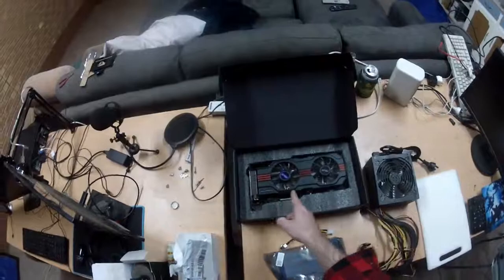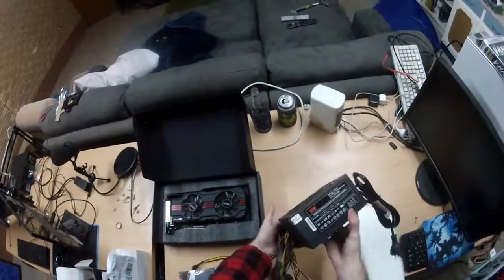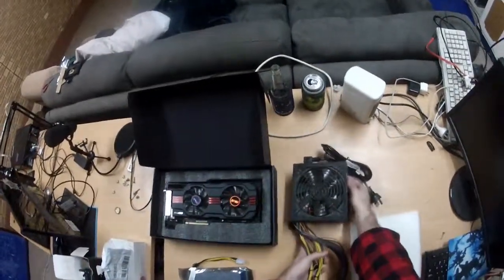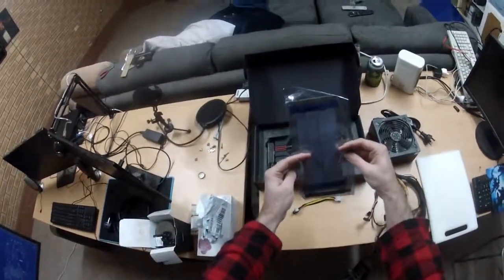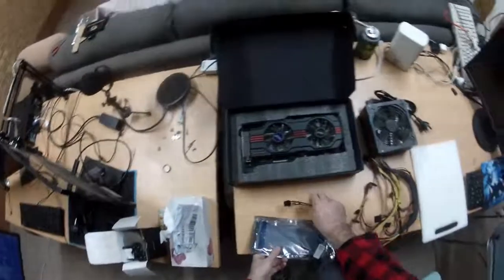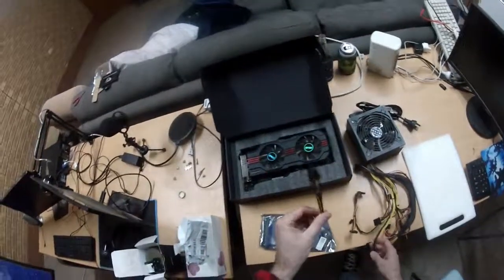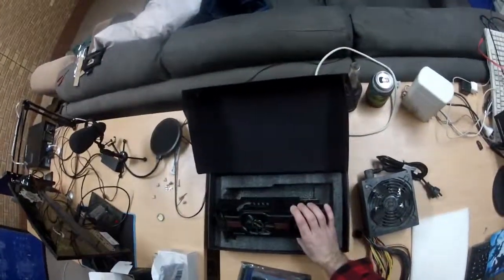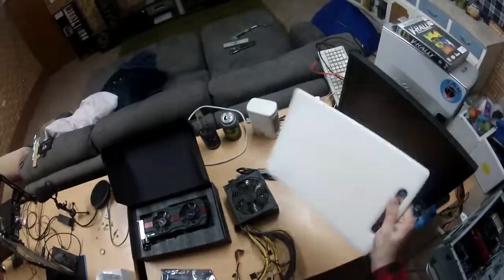To make this work in my case, the power supply that comes with the case simply isn't up to scratch. So I also have a very second-hand 700 watt power supply that I'm going to wire up next to it. I have a, what are they called? PCIe riser card, because that graphics card is just about as big as my entire case. And because the power supply is too old for the graphics card, believe it or not, I've got a little adapter cord that's going to give me 8 pins of power. It's a two power cord dealio. Oh, and I've got a chopping board to rest it on top of as an insulating surface.